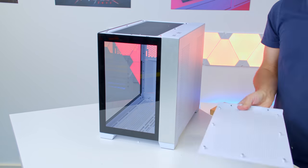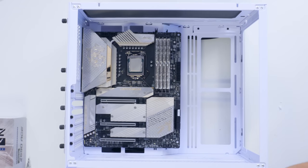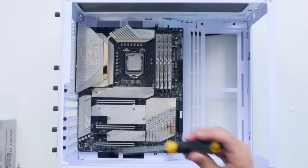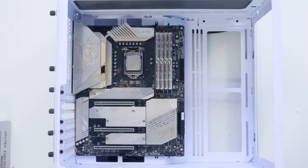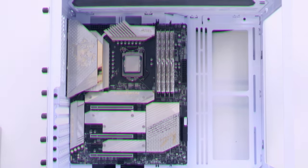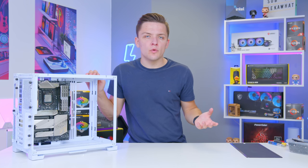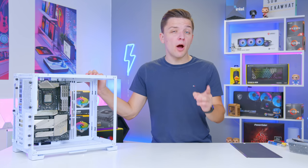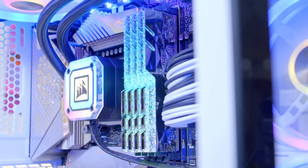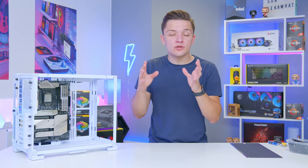Remove all of the side panels — for us that's the top, both pieces of glass, and the rear — before going ahead and screwing the motherboard into place. It's probably easier to lay the case flat on the table when you're installing the motherboard. I'm starting to like the look of this already. Normally in a build like this I would install the cooler next, but I'm thinking the power supply might be a better choice. This case is a bit more complex to build in, especially for an inexperienced builder, so let's do the power supply now while all the cables are really easy to access.